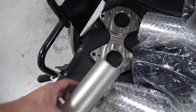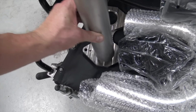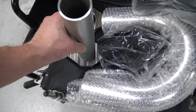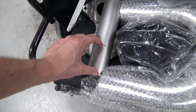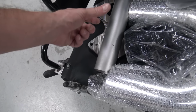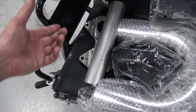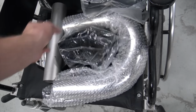These are the flanges that I designed, and yeah, I just need to cut this piece of pipe right on that line. Since the car is at the house, I'll just cut that, tack it, then figure out what angle I'm going to go off of that, and go up to the T4 flange, throw the EFR on it.